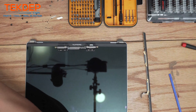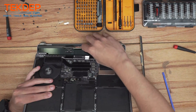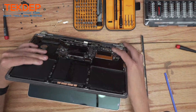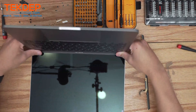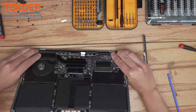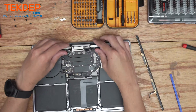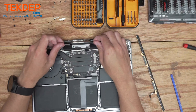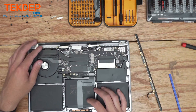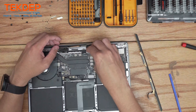That's our brand new LCD. Take the top case, line it up, you'll hear it click in, then hold the hinges and lower the top case down. If you're noticing that you're missing either the black pieces or the main LCD connector, it means it's trapped under the top case and it won't close all the way — open it up and try again. Make sure these sit in place nicely before doing anything else.